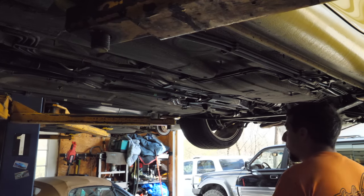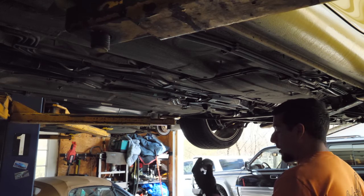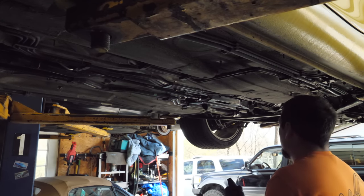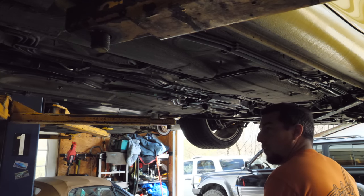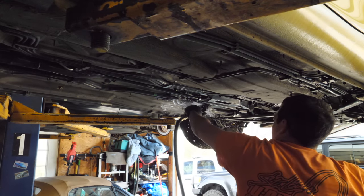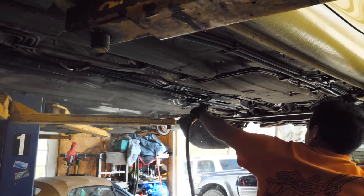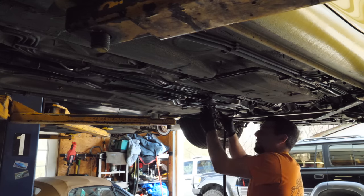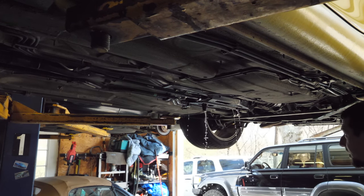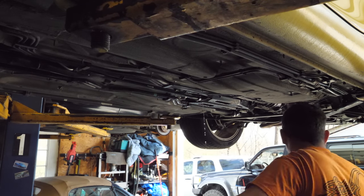It's down to a drip. We are nowhere near empty — these cars hold a lot of coolant. So the next thing I'm going to do is use my air compressor and an adapter from my vacuum fill system for filling cooling systems, and we're going to put it in one of the hoses and give it some air. It's going to blow stuff all over the place. There we go — oh! All right, I'm going to remove the other side of the hose and try to flush the front half with compressed air.